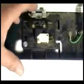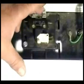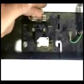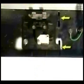Grab the lid switch assembly and move it forward until you hear the switch click on. Hold it in place and tighten the holding screw to secure the switch in place. The tabs should be about in the middle of the slots.